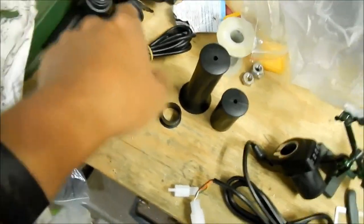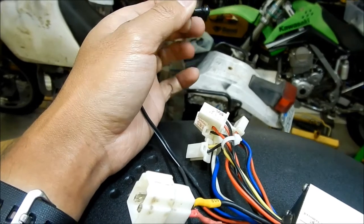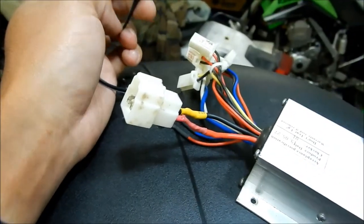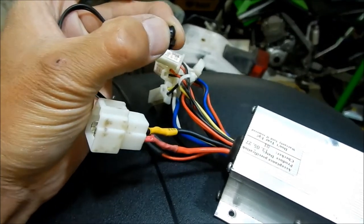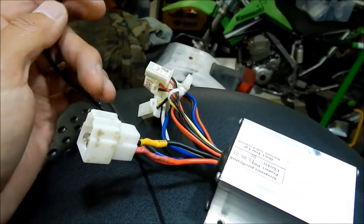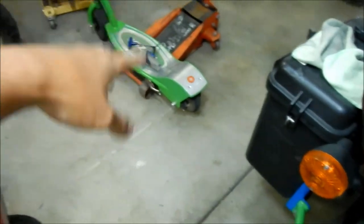Basically you can wire the lock to this wire here, and when you take the key out it breaks the connection and turns the controller off - no power. I found that out the hard way when I hooked everything up and wondered why it wasn't working - you have to connect those two wires together. What I've done is just twisted the two wires together so it's on all the time. The on/off switch on this is what actually turns it on and off - it just breaks the connection from the battery to the controller. The mechanical switch is right here on the scooter.